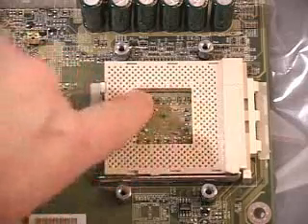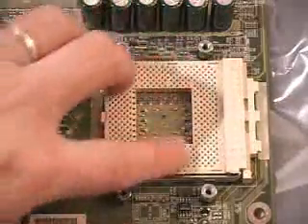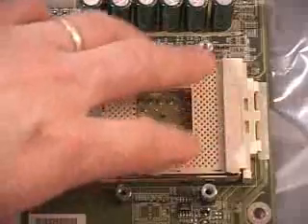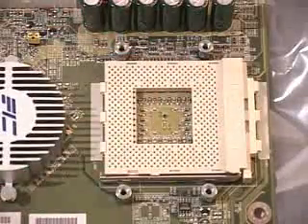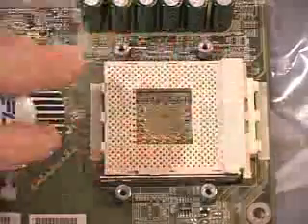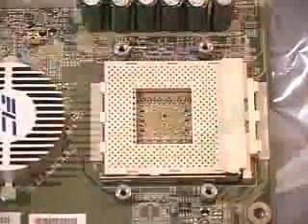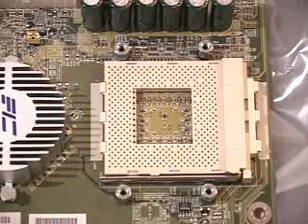The grease has to go inside the cavity all the way up and over the small socket pinholes. Everything in this area has to be covered with dielectric grease. Once done, slip the CPU in and make sure it is seated correctly. Then apply a paper-thin coat of thermal compound to the CPU.